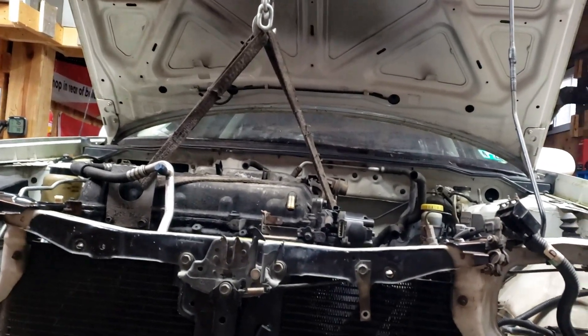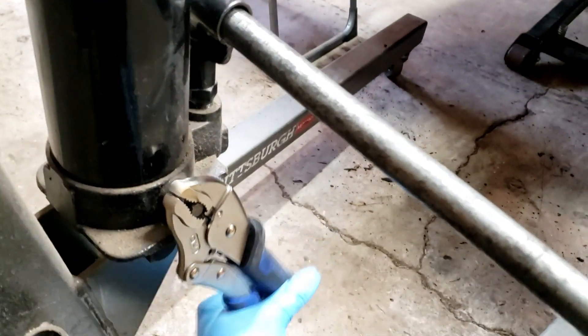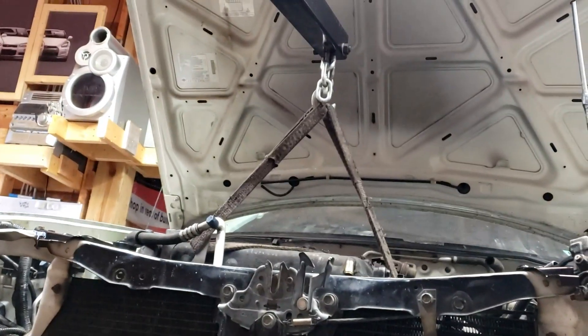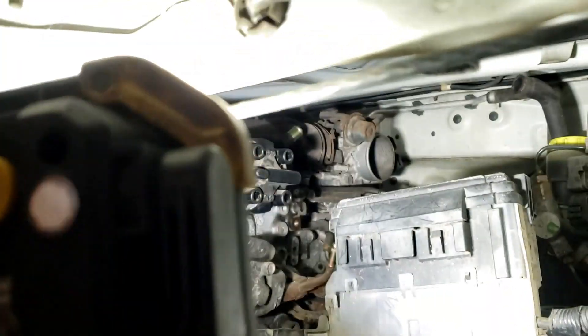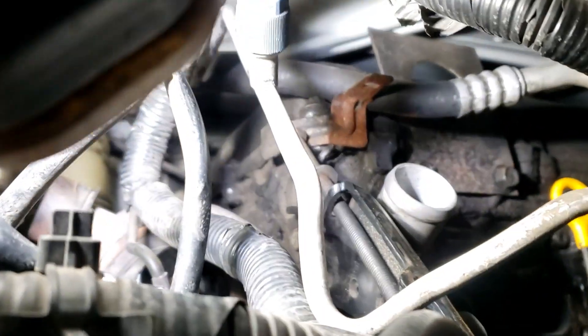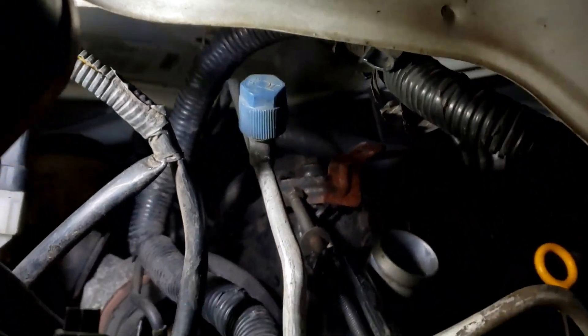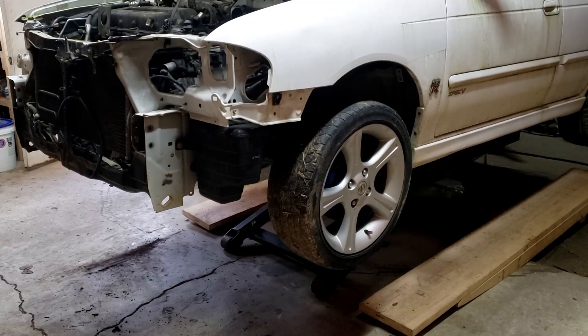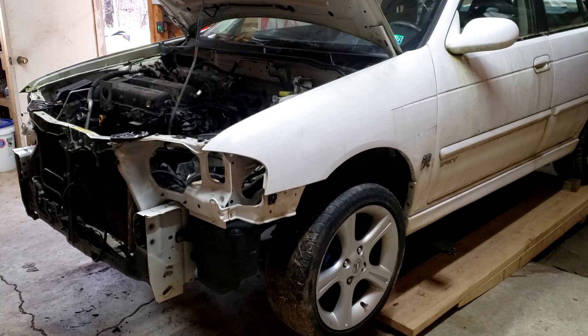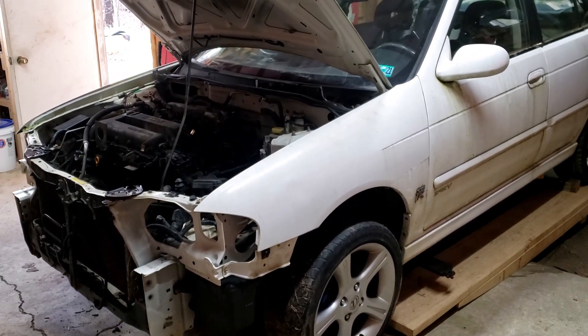Now that the engine mounts are tight on both sides, now's the moment of truth — if this engine can now be supported by the car instead of the crane. I closed the hood and latched it so I could do a clearance test; looks like everything fits pretty well. It's clearing pretty good in there. The lift plate even clears the hood, let alone the top of the engine. The top of the engine's got probably a good two inches. The intake manifold's the same since the hood goes up in the back. Perfect.